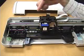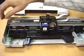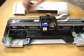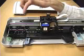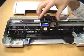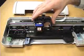This is the inside of a computer inkjet printer, and we're going to look at several components. We're going to look at two DC motors that feed paper into the printer and provide translation of the inkjet head. We're going to look at plastic digital encoders that are used to monitor the positions of those motions. We're going to look at the actual inkjet head and talk about how it works.